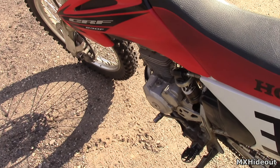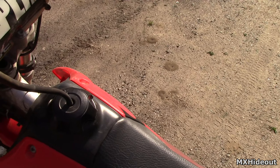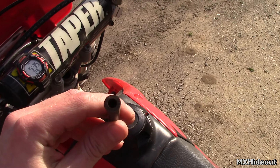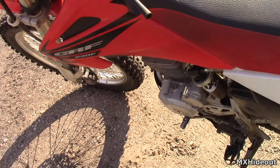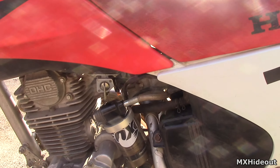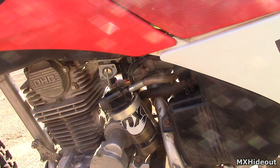On the rare occasion, there can be a vapor lock. Gas basically gets locked into the gas tank, and there needs to be pressure put into it to push it down to the carb. You can try taking the hose out and just blowing in it to pressurize the system and get it running again. This can happen if you have an aftermarket vent cap or if you have a fuel filter that is clogged — you may have to replace it to get fuel running back to the carb.